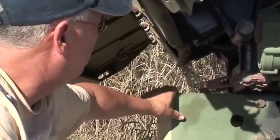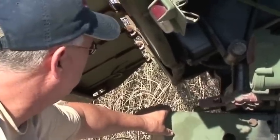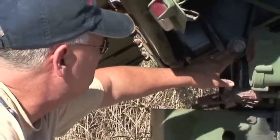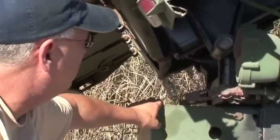These trucks have heavy-duty bumpers and tow hooks on the back, which were up in this area and were going to interfere with the truck bed, so those had to be removed. We did reinstall them in a lower position, but not putting them back on would also be your option. That's one thing you have to look at — where the hinges are going to be placed on the truck frame, how much overhang you have, and whether there's going to be interference.